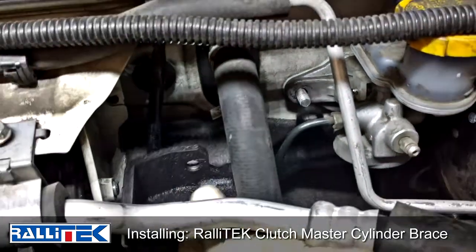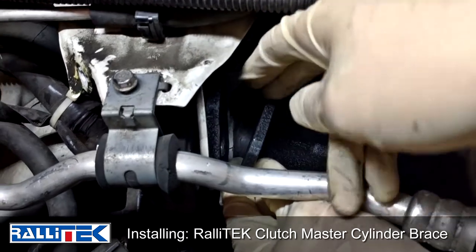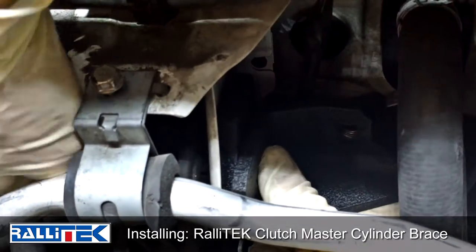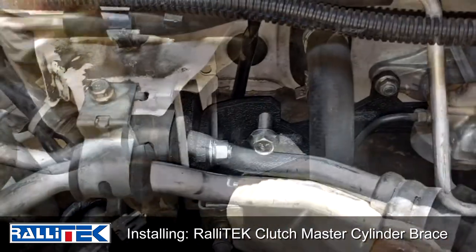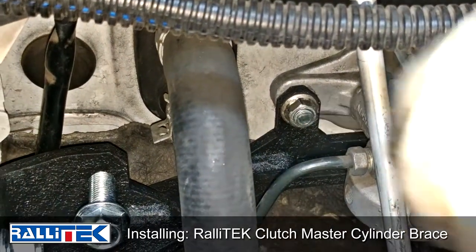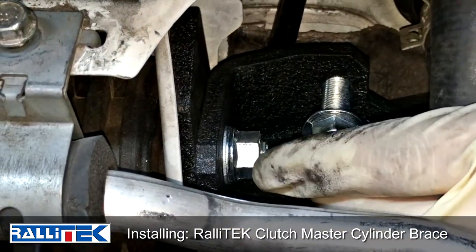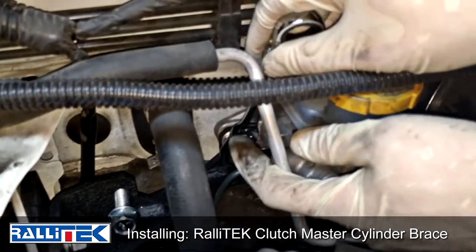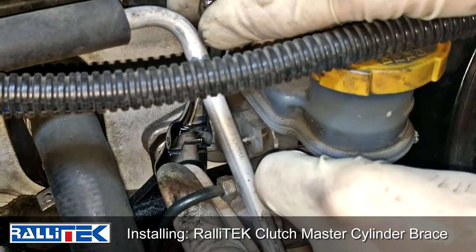Put your nut in over the top — both nuts can go back on in a second. After we get this back plate in, the back plate goes over the top of the nut; this helps distribute the load better over the whole surface area. Then we can go ahead and zip that M10 bolt the rest of the way through. I went ahead and got both nuts down almost 100% tight, then came back to this M10 nut and washer, snugged this down to torque spec. Then I'll come back to these last two on the clutch master cylinder brace and torque those to spec as well — working everything down together since it's a tight fit, to make sure tension is even throughout the system.